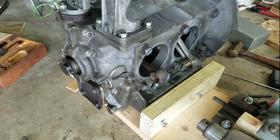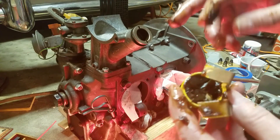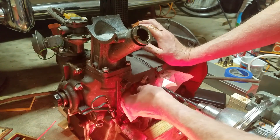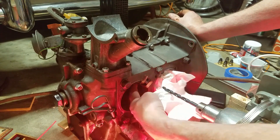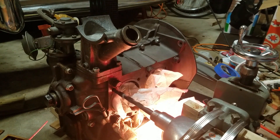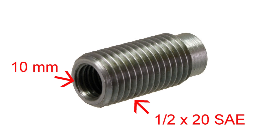Next, I prepare to drill the holes. In my case, 9 of the 16 stud holes are open to the inside of the crankcase. I don't want any chips from the machining operation to get into the crankcase where they could plug the oil galleries or get into the bearings. So I fabricate a chip catcher using an old lip balm jar and some phosphor bronze, fill the jar lid with grease, put it behind the open hole, and turn the crankcase until the counterweight presses the chip catcher tight against the inside of the crankcase. Then I stuff paper towels into all the case openings. I'm using case savers with a 10mm inside thread and a ½×20 SAE outside thread.